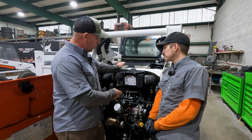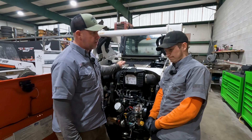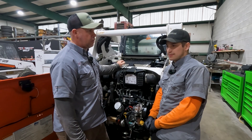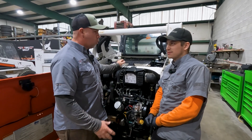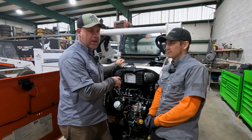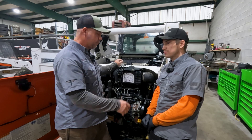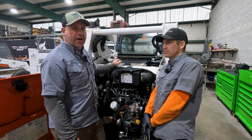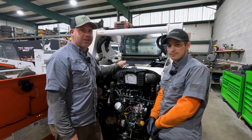With a mechanical gauge, the downside is you have to take your metal high-pressure lines off, which you never really want to do — and at 26,000 to 30,000 psi capable, it's dangerous if you don't know what you're doing. We'll show the mechanical gauge option in a future video, as it's also a good tool to have in your diagnostic toolkit. Any questions, let us know. Thanks for watching.